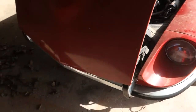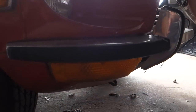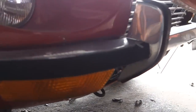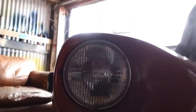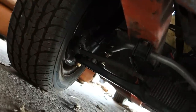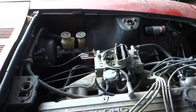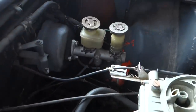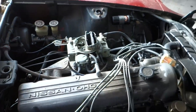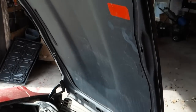It still has its bumpers, so I'm going to pull all the bumpers off and have them re-chromed. I'm going to get new bumper pads — you can still find that stuff. I pulled all of the front suspension out of this car and rebuilt everything — pulled all the A-frames apart, dropped the subframe. First thing I did to it. Then I started on the brakes — I put a new booster and master cylinder on it, new calipers. I still need to do the rear brakes.